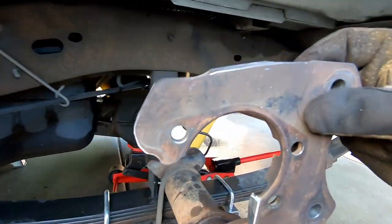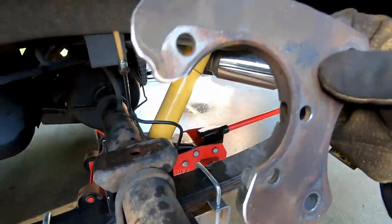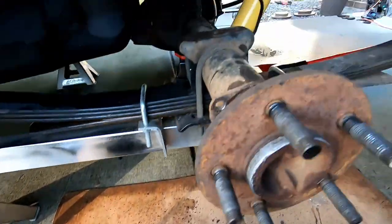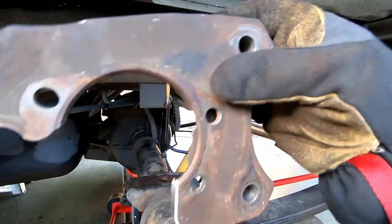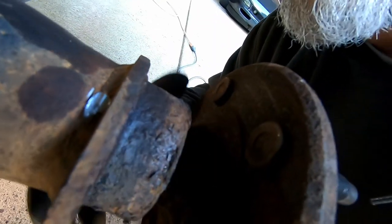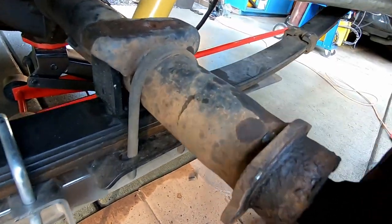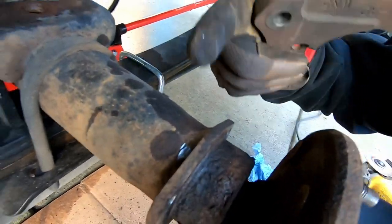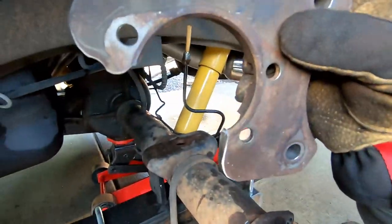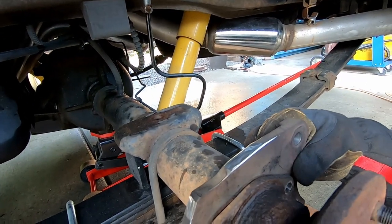This is the right-side Mustang bracket going on the left side. On a Mustang, these brackets go on the outboard side of the flange just like the backing plate does. When we put the Mustang brackets onto the Ranger, it goes on the back side — inboard. You've got to look at this weld. There were a couple of places on this axle housing where there was a big bead protruding out, so I just ground that off so the bead was consistent all the way around the back side. That'll let the bracket sit as close and flat as possible.